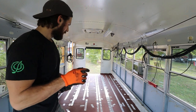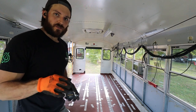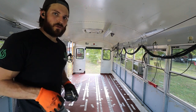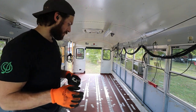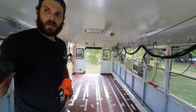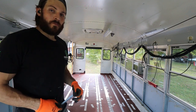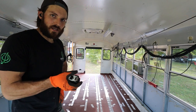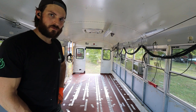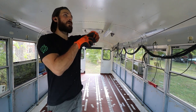The reason I'm going with two-by-fours is to make sure that where my boards are meeting I have a two-by-four there, so I'm screwing the plywood directly into them on both ends for strength. I went with a moisture-resistant type of OSB for the subfloor. We'll get inch-and-a-half insulation in the floor, which I think is pretty important. I double-checked and made sure we'd still have the headroom.